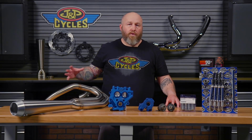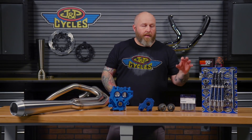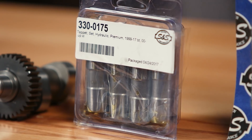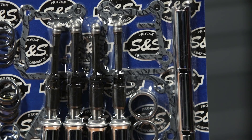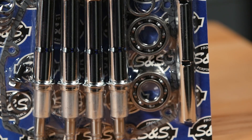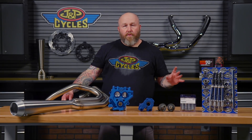It'll work well with these full exhaust systems. When you put these cams into your bike, it's the perfect time to upgrade lifters and pushrods. When you do these cam systems, to avoid taking your rockers all the way apart and pulling apart more of your motor than you need to, you can use these S&S Quickie pushrods. You bolt-cutter out your stock pushrods and these quickie ones will go back in there without having to take the rocker boxes off — a great step up from stock that will save you a ton of hassle.